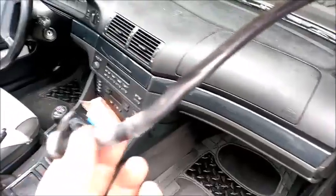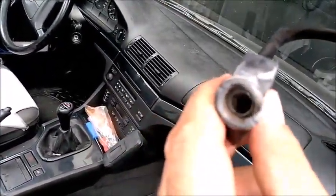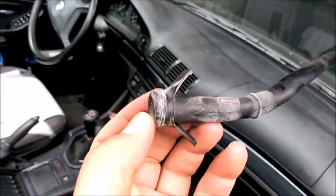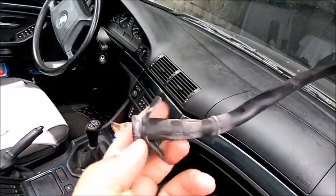Since you're removing the drain plugs, it's now the perfect time to remove any rubbish inside. Clean it out, and before you put the new cassette drain plugs, you have to put silicone oil around the drain and put the caoutchouc back. It has 2 lips like this, which will flip in and out.